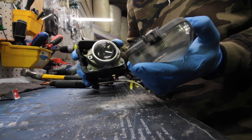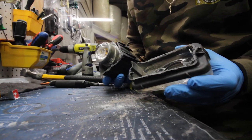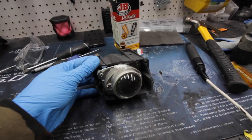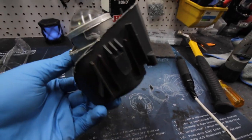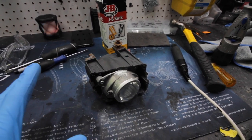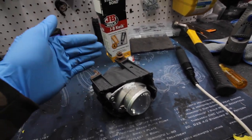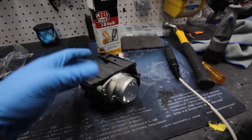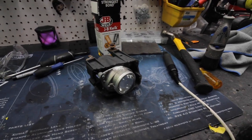There's a bee in there! Going to get some compressed air and start cleaning this out. Oh, and there's a spider — there's people living in here, sorry. Now that I have it open, I'm getting the projector itself out. There's some corrosion on top and a little bit on the bottom — I'm going to clean that up. The other side was actually way worse because the back cap was cracked when I first bought the car, so it was leaking dirt, debris, and water from the back side.